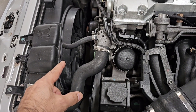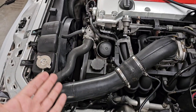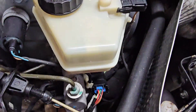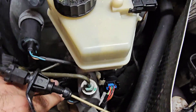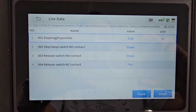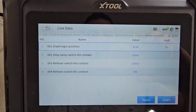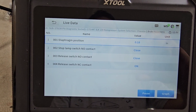The control unit for the fan is over here — very important if you have a problem with your fan. The next module is the brake assist module, which you can see here. It has CAN signals — the white and green wires. The information you get from the BAS module means that if your brake switch is faulty, you will definitely have your BAS and ASR light on the dash.